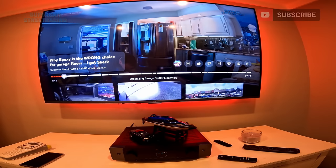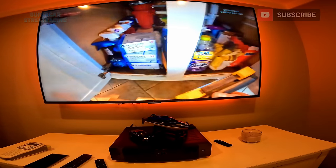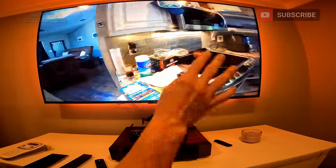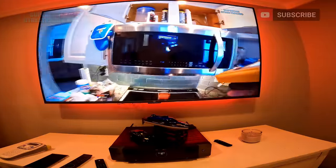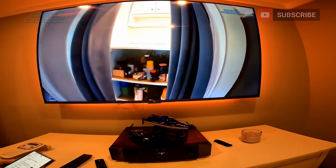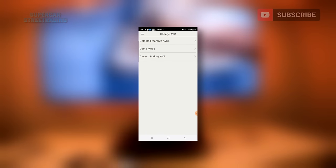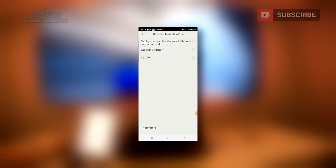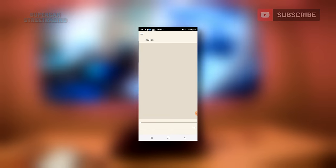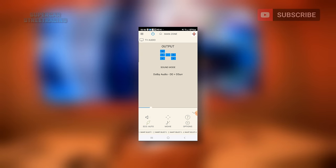It is not outputting audio to the subwoofer. I did figure it out — it was set on full range for the front speakers. I set it to crossover at 40 hertz and now we have subwoofer audio. I'm going to go ahead and get the HEOS app opened up. It found master bedroom and it found studio — I'm going to select master bedroom. It is on Dolby Audio, Dolby Digital Plus, Dolby Surround, so it's on auto.